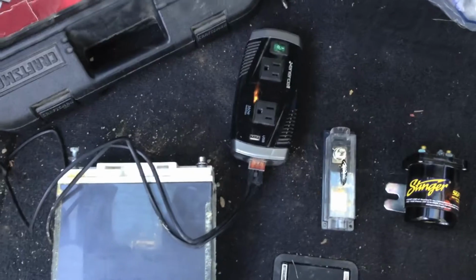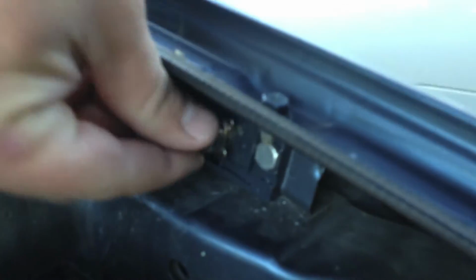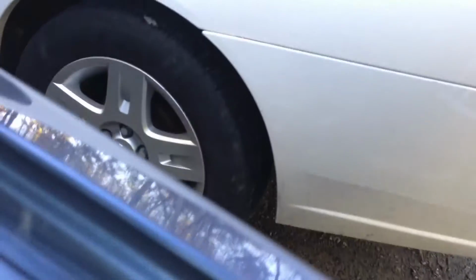So, yeah, I got my fuse block mounted, bolted up front, which is a pain because I can hardly get around back to get that. I used a Molly toggle bolt in the back here, put it through that hole. So that's the most secure I've ever had a fuse block. Usually they just sit in the engine bay, or you use a self-tapper that comes loose a little bit down the road, but I just about fried my face in here. I was getting that tight.